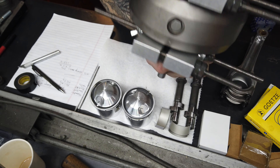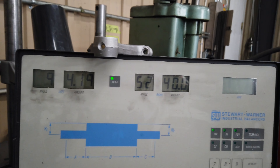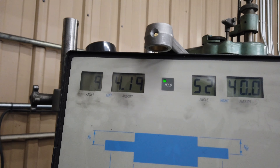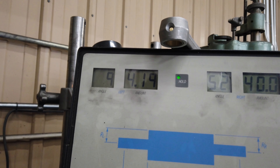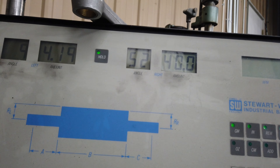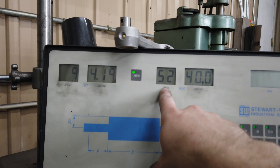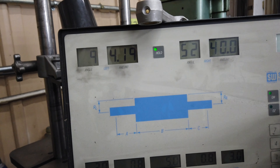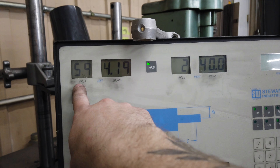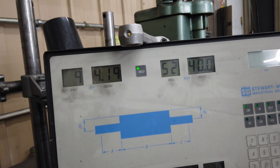Now it's all set up. Wow, that's not bad at all. I'm going to spin it again just to make sure, but right now on the drive side it says I need to remove 4 grams, and on the timing side it says I need to remove 40 grams. Not too bad. The angle at the bottom is 52, angle at the top is 9. If I switch to 'add' instead of 'remove,' it wants me to add at angle 2 - which is impossible - and add at angle 59, but 4 grams is not worth doing. I'll spin it again to double check.